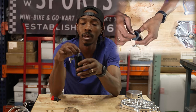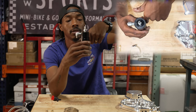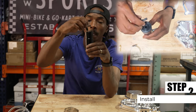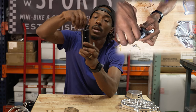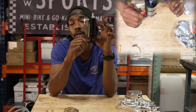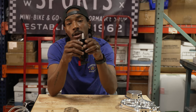Next I install my top fitting — this is where ventilation comes from the head itself, blowing past the actual vent. You can say this is positive crankcase pressure, and this is negative pressure that's releasing. Once I get the top one installed, I move over to the shutoff valve. The shutoff valve is installed into the bottom of the tank. Its sole purpose is to let you drain your tank periodically as part of mini bike maintenance. Keep in mind the tank is filling up over time, so every so often open up the shutoff valve — if there's oil in it, it'll drain. When it stops draining, shut off the valve and send it.